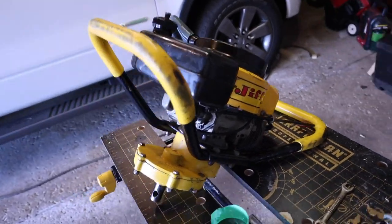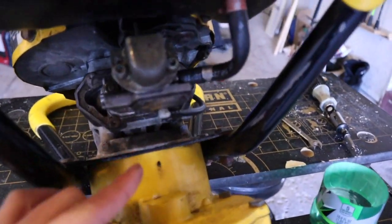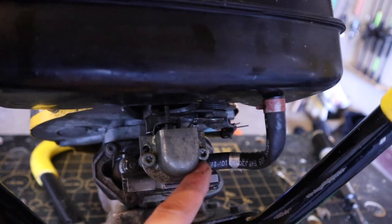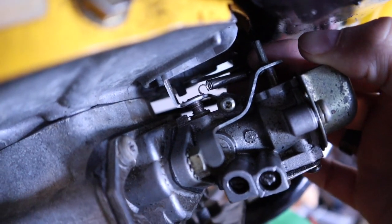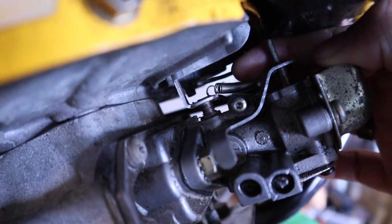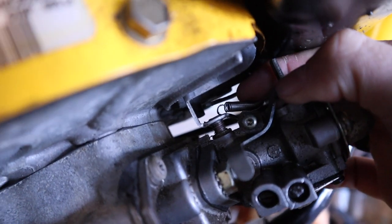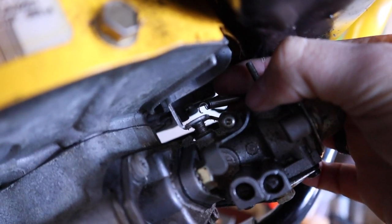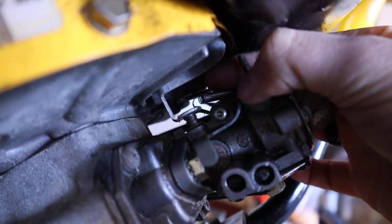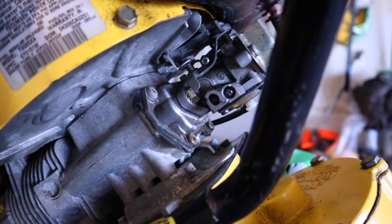Here's our beautiful Jiffy. Now if you guys are completely new, this is your carburetor right here. All this linkage looks pretty confusing — you don't think you're going to be able to remember how to put it all back together. If you look at my finger right there, there's a spring. That spring goes into the plate that it's touching. Your first step is to get long nose pliers, grab this spring right here, and take it out. Once you've done that you're ready to disconnect the carburetor.